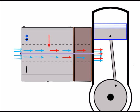So as a general explanation then, this is what we've got going under normal working conditions. There's air coming into the carburetor this end, through the air filter of course, and then it enters through the venturi, and at this point the fuel is added to the air, shown as the red arrow there coming from the fuel jets as it enters the venturi, which as I've already mentioned, the amount of which can be adjusted by the high and low mixture screws here. But when the fuel enters here, it mixes with the air and it becomes a fuel-air mixture, which continues down the rest of the carburetor and through the inlet manifold before coming out into the engine, where it's used for